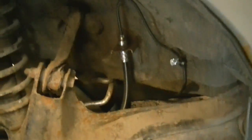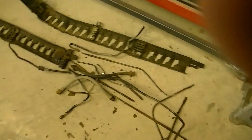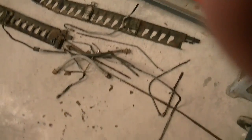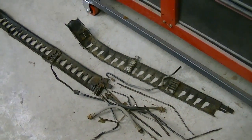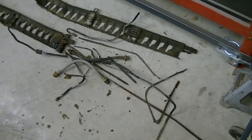Back around and head into here. Now both brakes have brand new brake lines from front to back. I didn't do the front brakes — looks like they're still in pretty decent shape, I may look at it a little bit harder. But definitely the back brake lines were totally trash. Most of that stuff just plain fell apart. It's all because of the stupid cover they put underneath there — it just held the salt in and rotted the lines apart. So I'm going to leave that exposed. I'm not sure if that's the best idea or not, but I don't think it's going to really matter too much for all the longer this car is going to run.